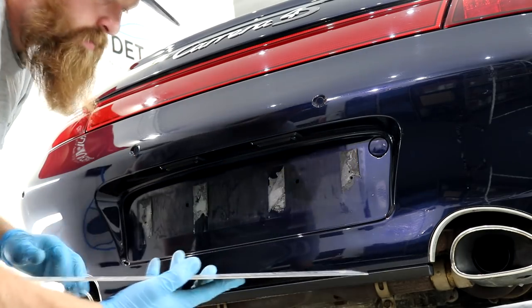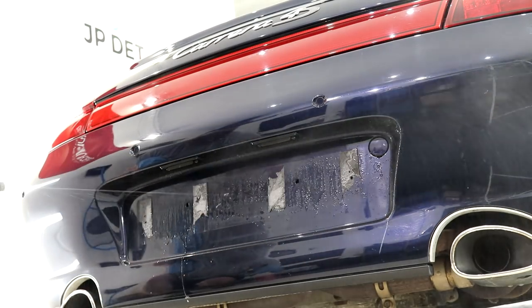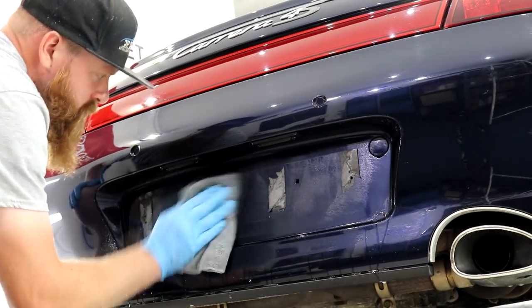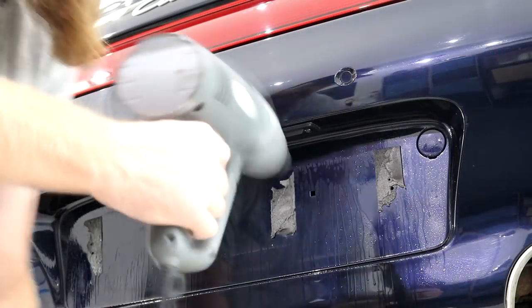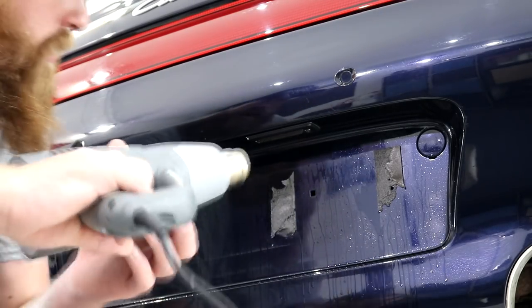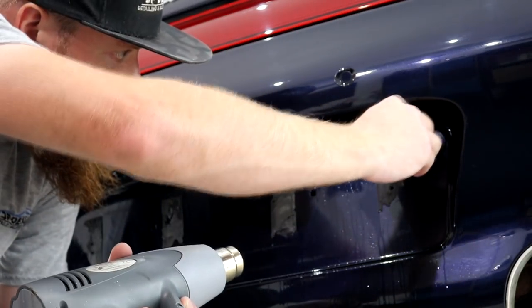Depending how obsessive the previous owner or dealership was with the sticky tape will determine how long it will take you to remove those sticky strips. Once again, using the heat gun and periodically spraying some tar and glue remover whilst peeling back the sticky tape is going to work wonders.